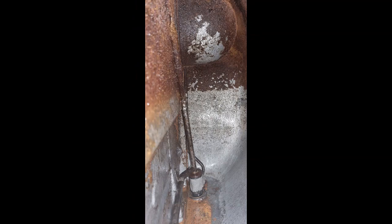This is the image I took prior to putting the Renex rust remover in — you can see the electrolysis has done a pretty good job. This is the image after the Renex had been in the tank for around 24 hours; it's turned the rust black and filled all the little holes the electrolysis wasn't able to get into, so it's done a bit of a job. And this is what it looked like after I washed the tank out with water.